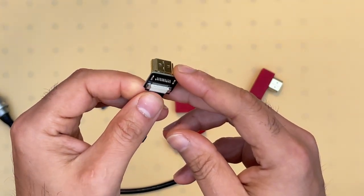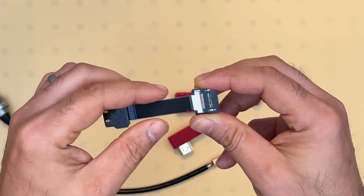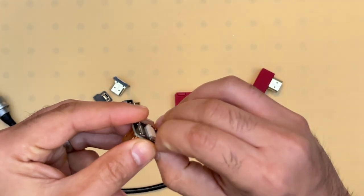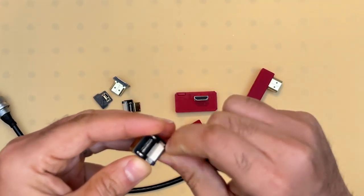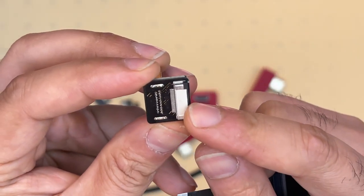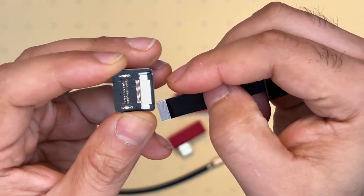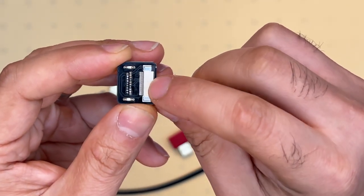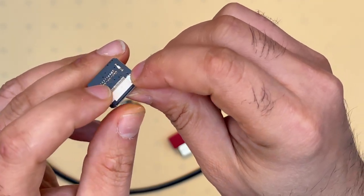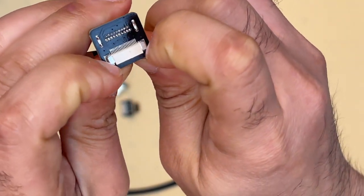When you receive the monitor itself, it may come with a package of these ribbon cables and they're not pre-assembled. I will demonstrate the assembly of this type of connector. This type of connector has two prongs that you want to pull apart and then insert the ribbon cable. You don't want to use any tools and you don't want to pull on these things too aggressively, otherwise you may damage the connector — this is a very delicate connector. So just use your fingers and push those two tabs out.